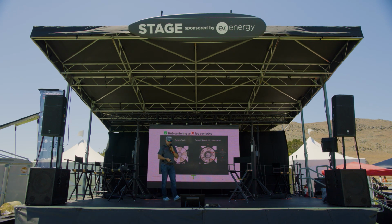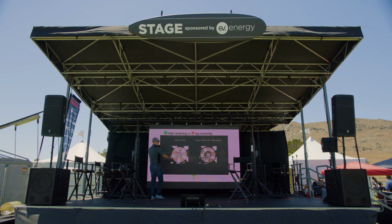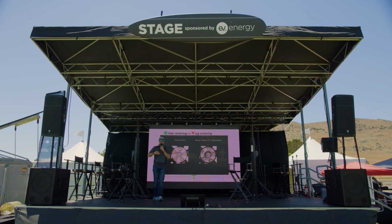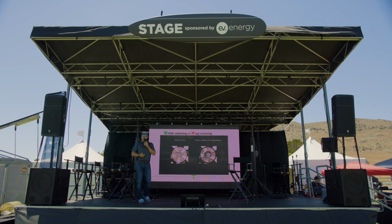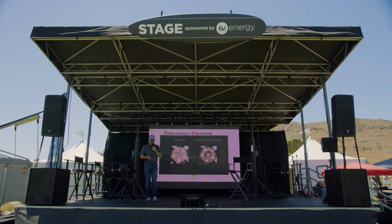The other thing I show in this picture is on the factory Tesla wheels, they have these little water extraction ports. So any moisture or water in there can exit from the hub. A lot of aftermarket wheels don't have those, and you end up having water collect in there, and it can corrode the hubs in the wheels.